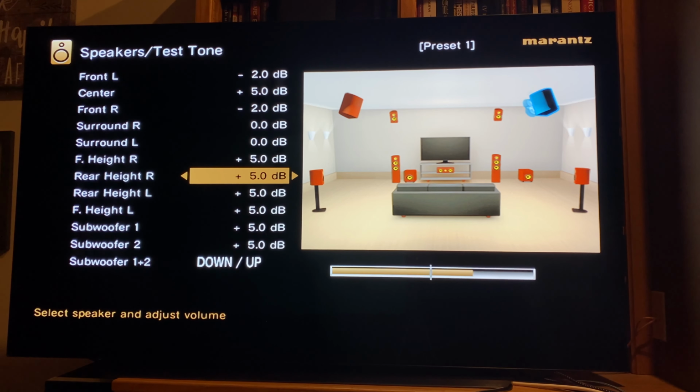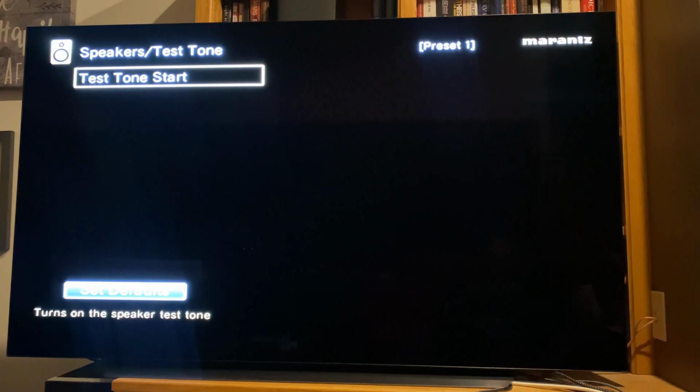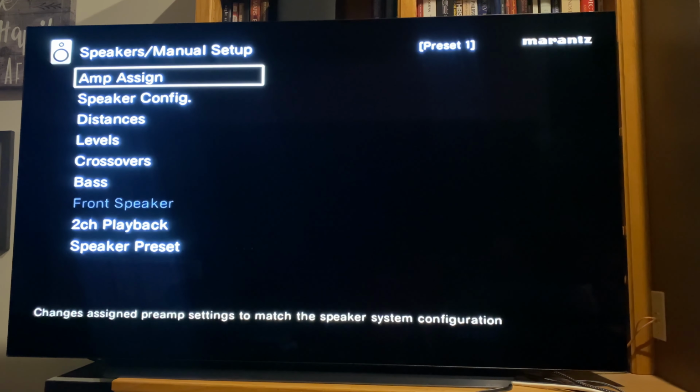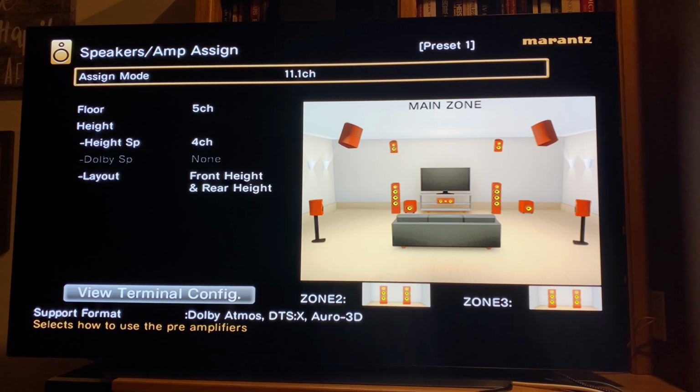If you want to know if your speaker has bass coming out of it, what you do is set your speakers to 2 channel, then set those speakers on large, play music, play content without your sub, and see if those speakers alone can produce bass. And if those speakers can produce bass, that's great, that's wonderful. And if your speakers can't produce bass, your subwoofer handles it anyway.